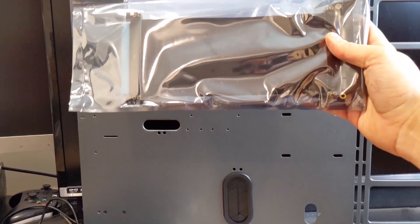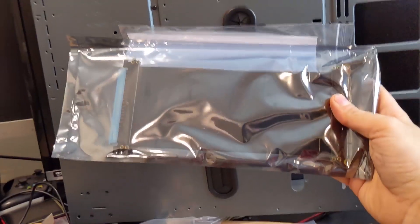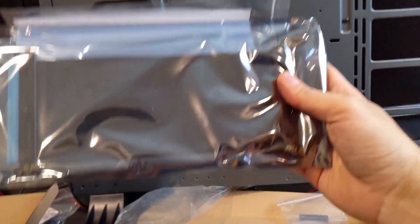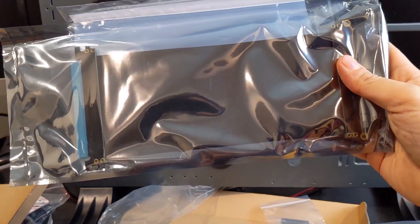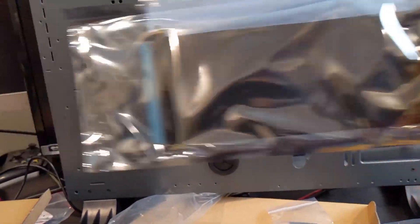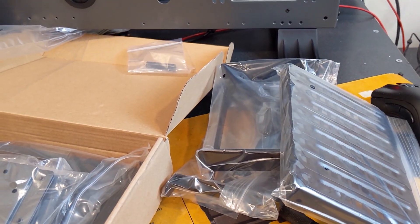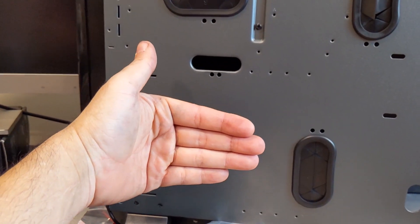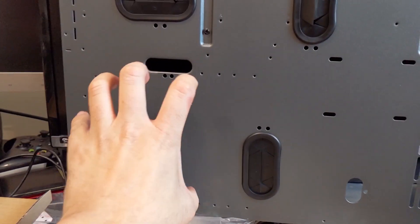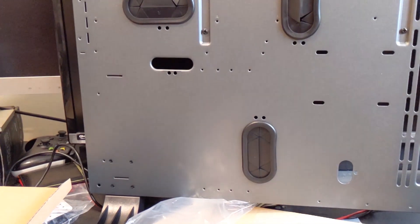Because this is a P5, it comes with an extension cable — they don't always do that. I have another one I bought elsewhere, so I'll use that one since it's already been used once. And if I run SLI, then I'll have two of them. That's a lot of different stuff for different options — you can mount the PSU this way, that way, whatever way you want. It's going to be mounted with the fan out, sucking air in and blowing it that way, which is how it should be.